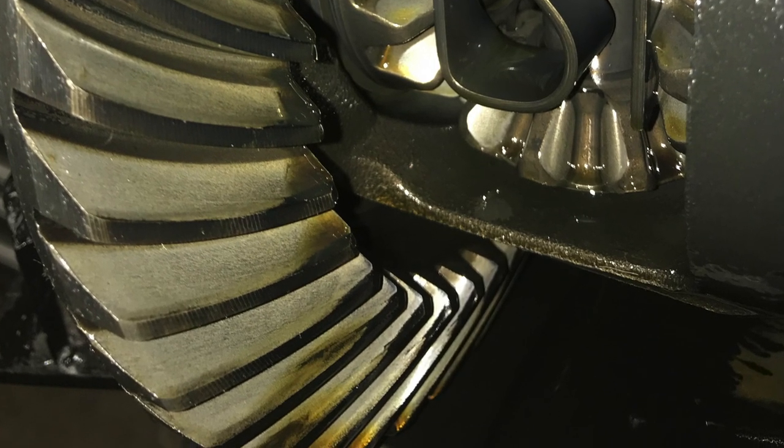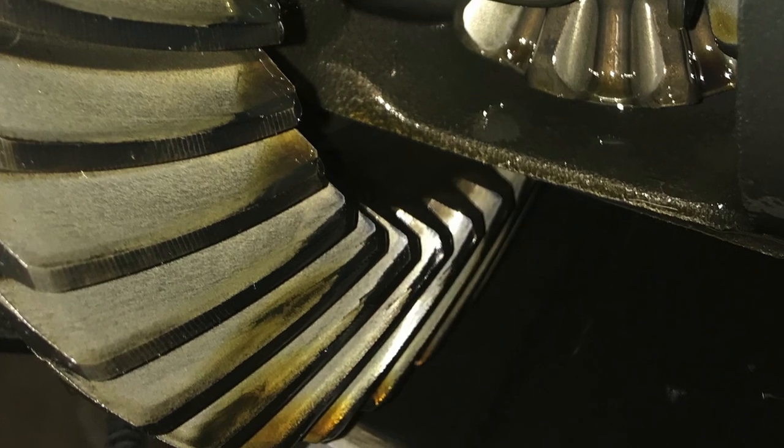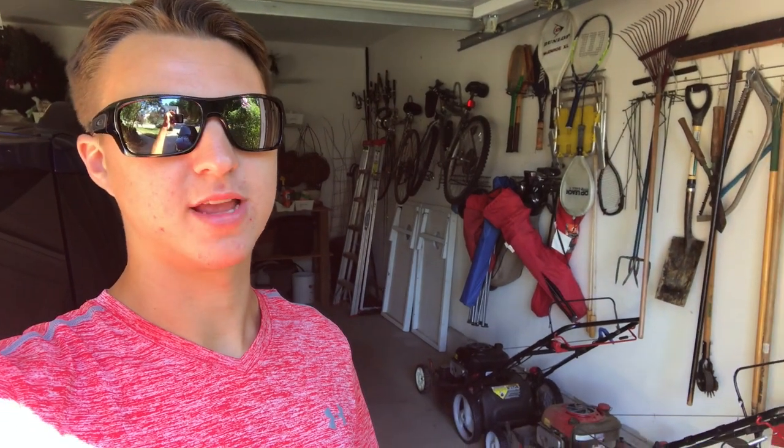If you're doing this yourself and you're looking at it, make sure to check that. If you take pictures of it and have somebody look at it, the diff grease does look like it's a chipped tooth. So with that being said, instead of changing gears and everything — because 3.55s are going to be plenty — what I'm going to do is change the diff clutches, because I'm worried with 100,000 miles on the rear end that it's going to have slip and I want the clutches to be good.